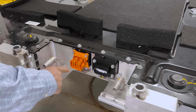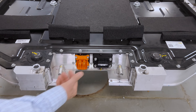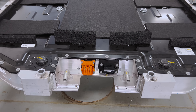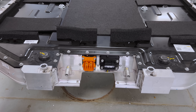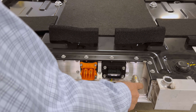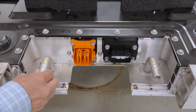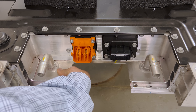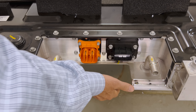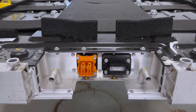You can see the other high voltage connection. There's a front drive unit and a rear drive unit on this vehicle, so there's one high voltage connection for each, plus a low voltage connection where all your normal control signals and communication connect to the pack. There's also the single inlet and outlet for cooling. You can see these fittings connect directly to the cold plate assembly that forms the bottom of the pack, with a composite structure underneath that as well.